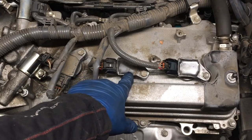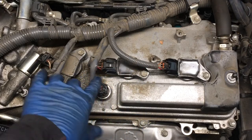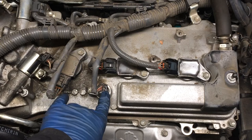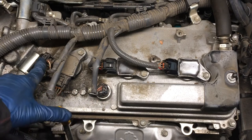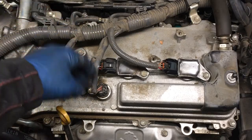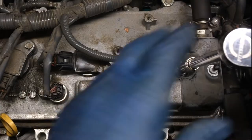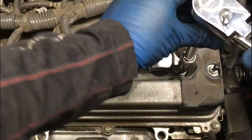you can remove the ignition coils on the harnesses. What you got to do in that case is unplug this cam sensor and this VVTI solenoid on the harness so that you can pull the whole harness up with the coils. On this coil, you can take the coil out and get to the spark plug by just removing this fastener